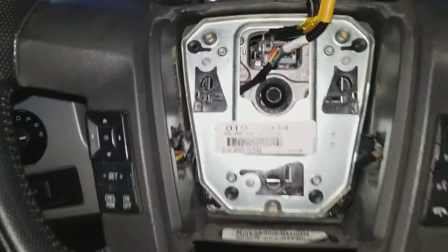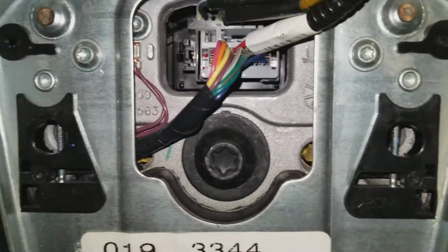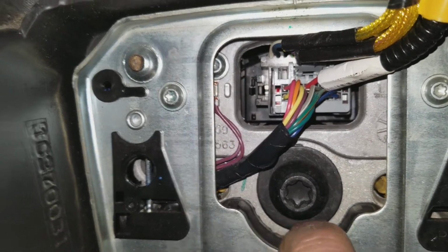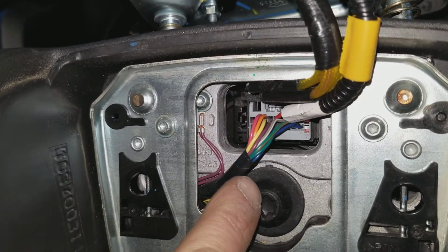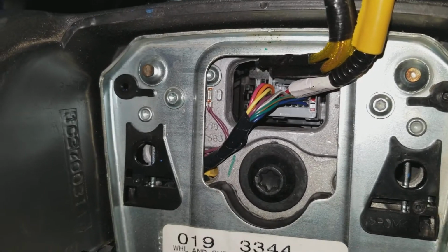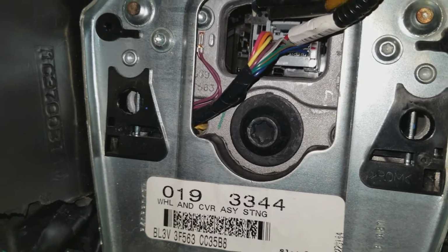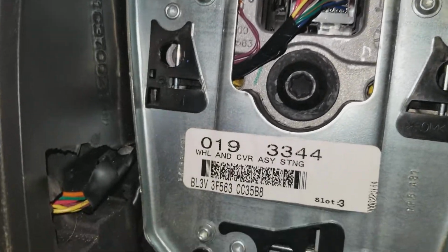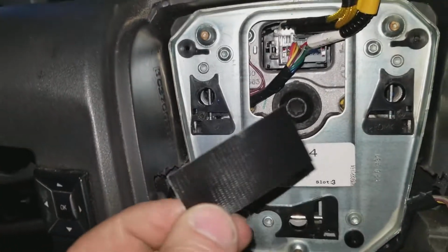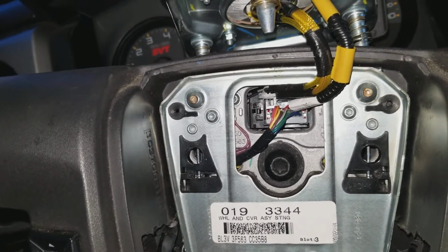Excellent. So, the rattling noise. Let me show you. Hear that? It's coming from this bushing and this cable. If I lift the cable up just gently away, see, it's gone. And if I bring it back, it's back. So what are you gonna do? You're gonna grab some Gorilla Tape, which is extremely sticky stuff, highly recommend, or use the trusty old electric tape.